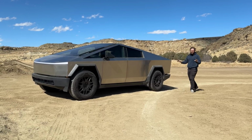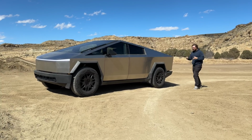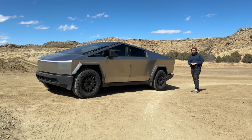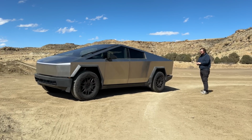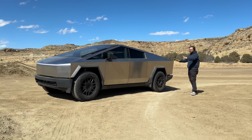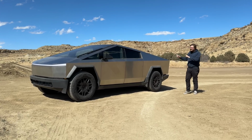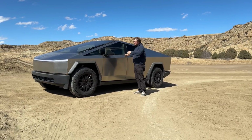And that is really hard for software to do, because how much power do you put? Do you put a lot, and then the vehicle comes over an obstacle, and you're still giving power and you're going down. So you need really fine-tuned software controls. And my perception of where the Cybertruck is today, we're going to find out here in a moment, is still very early days for this powertrain control logic. The hardware is all here, but the software needs to come. I mean, the locking diff is proof of that. So let's see how this does in the same, I guess, sort of split mu situation.